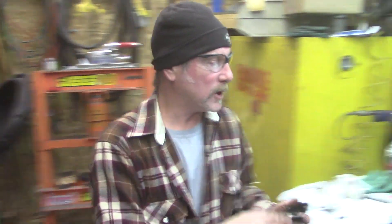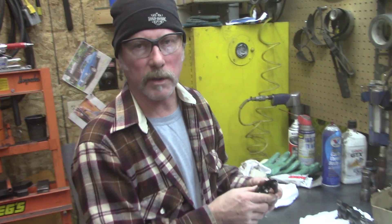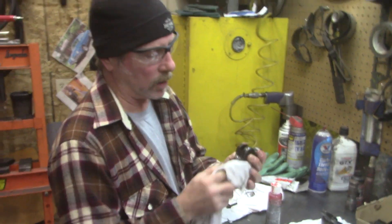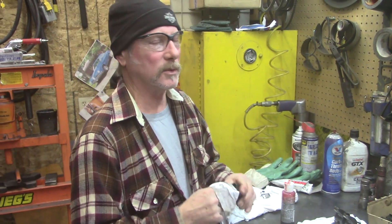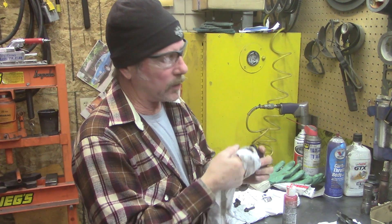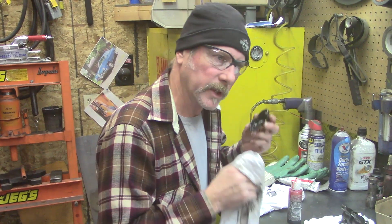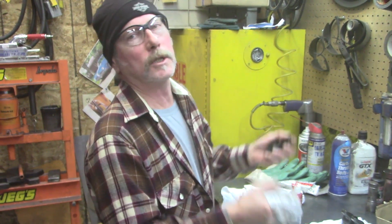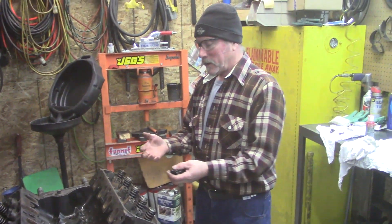It's been worn in, so all these parts were put away the way they came off the engine and we're putting them back together, because all these parts have already broken in with each other. We're just lubing it up, trying to get an extra couple years off of it. A guy had a 351 Cleveland — it was called a two-barrel — and nobody at the parts dealers would even know what the engine was. He was putting tons of miles on his car, never changing the oil. It started making a noise, so I said you can hear it with a screwdriver against the valve covers. I couldn't get the valve covers off — it had all turned to gel.